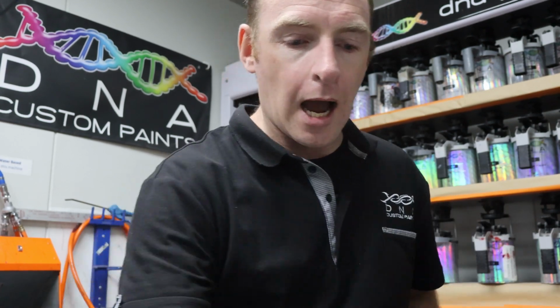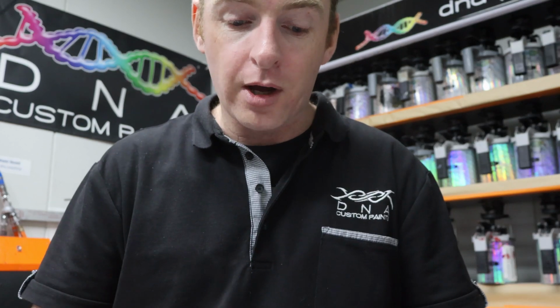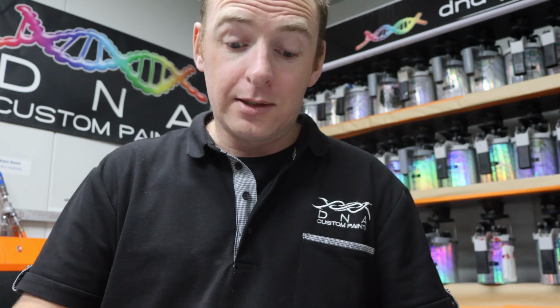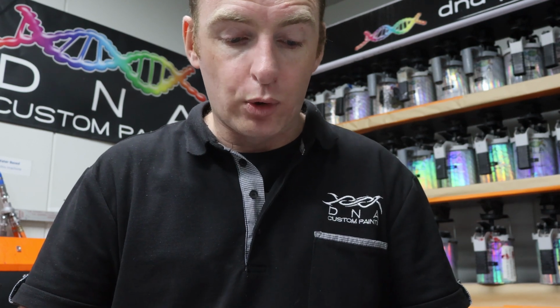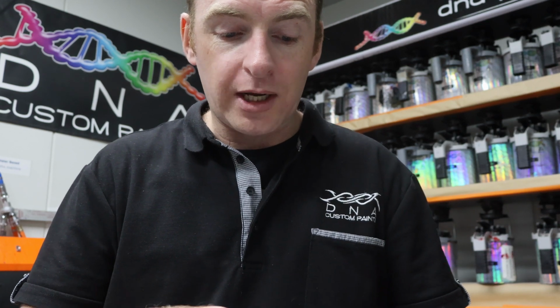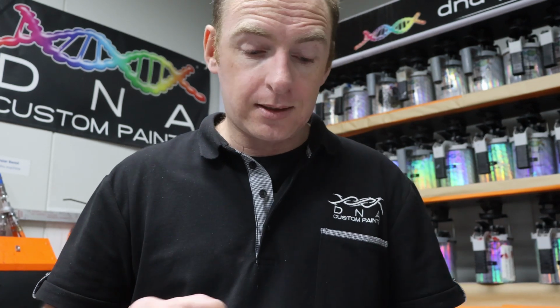Yeah, it's really, really good. So to give you a bit of a rundown on it, I don't want to bore you with too much of the technical stuff. But basically a quick little description of it. Protects sheet metal iron parts from rusting further and permanently prevents rust damage, even on parts that have already rusted. It is categorized by high coverage, it's weldable, paintable, fast processing time. Rednox is dust dry in 10 to 15 minutes. Touch dry in 30 minutes.